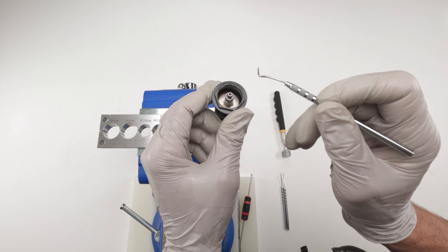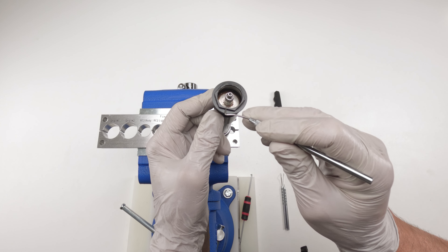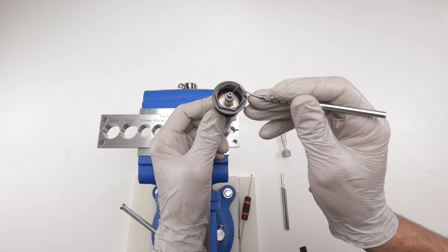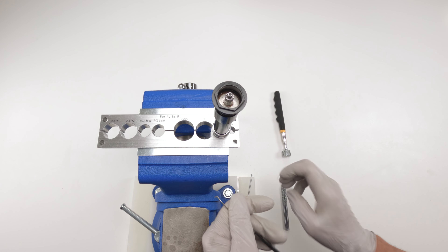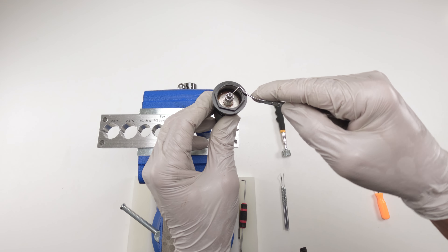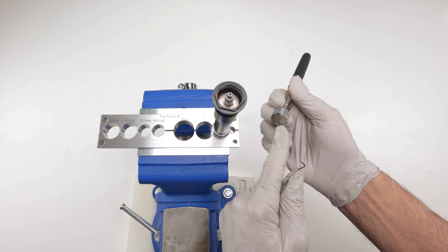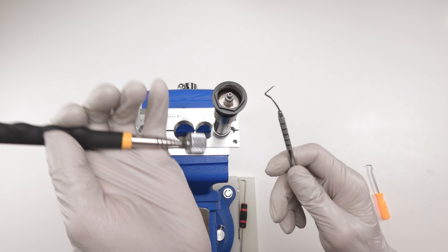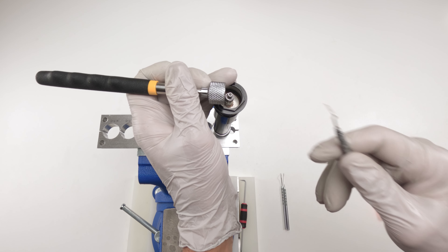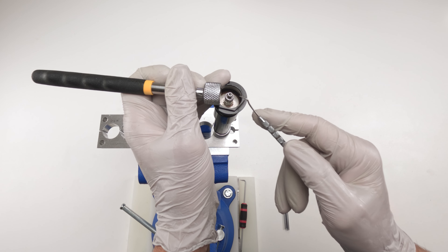This next step could be a pain in the butt — there is a really small C-clip on the inside. To get to it, there are two holes on each side of this dial. You have to get a small thin pick — the holes are so small you can't use a regular pick; typical picks are a little bit thicker at the tips. I absolutely highly recommend using a magnet when you do this job to catch that C-clip, because once it pops out it has a tendency to fly across the room. Fox doesn't sell that C-clip, so do not lose it.